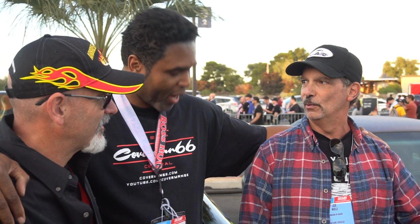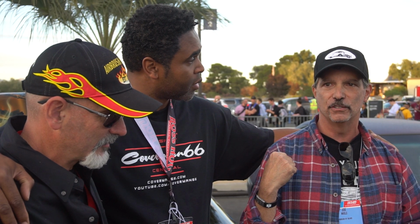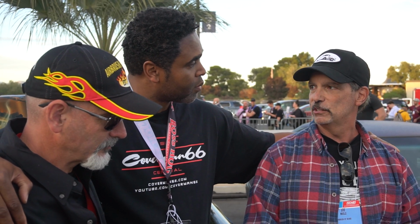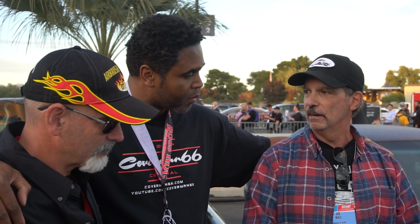And again, going back to the moonshine days, the transmission's an old clutch turbo. You take the Turbo 400, whack the front off, put a scatter shield. So that's in here, built by my buddies at JW Transmissions in Rockledge, Florida. Good guys over there. And I wanted power steering, I wanted power brakes, and I wanted air conditioning. I didn't want to see anything.